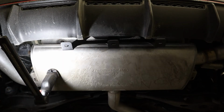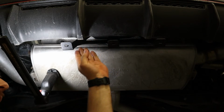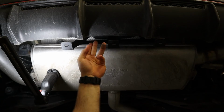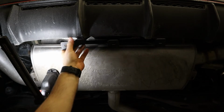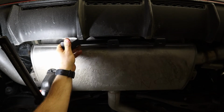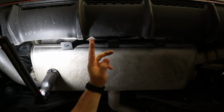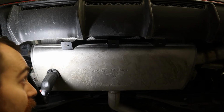We're going to do our best to make the vertical part of the bracket parallel to the bumper. And that is because with basically one bolt, the bracket can swivel. We do have slots on the rear diffuser, but you won't be able to move this once we tighten this down. So make this part parallel to this, and that's where we're gonna go with the rear bracket, and then tighten that down to about 6 foot-pounds as far as tightening torque.